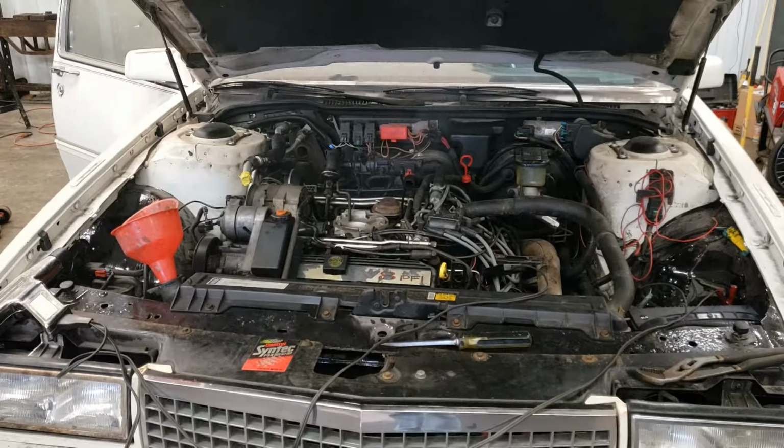That smoke, if you see any, yeah, you should see it. All that smoke is the never seize where I bolted the manifolds to the heads. I put a lot of never seize on there. That stuff will smolder and smoke away. It was caked with oil to some degree. Plus, it's a bare exhaust leak, like I said back there, from that air tube in the cat.